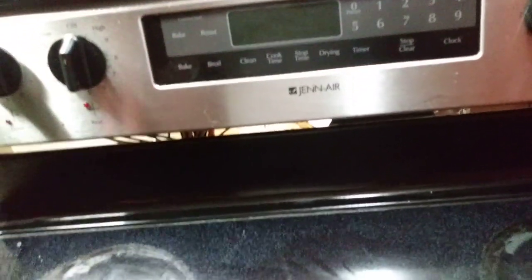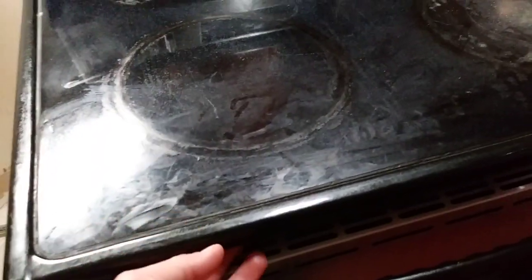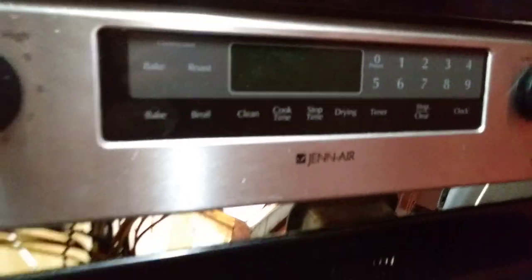If you're attempting to do this, you basically need some know-how. I went ahead and disassembled this before — this is just for demonstration purposes that I put it back on. Basically, open up the oven. This is a Jenn-Air; it may be different for other models. But there are screws right up in here — it meets up and screws in right here — and the top comes off.